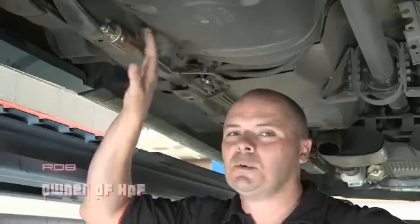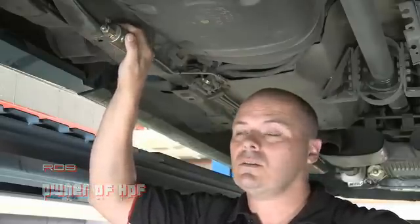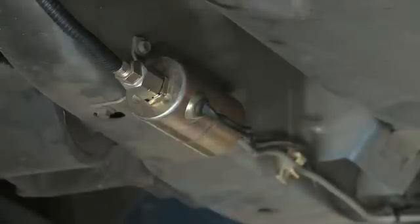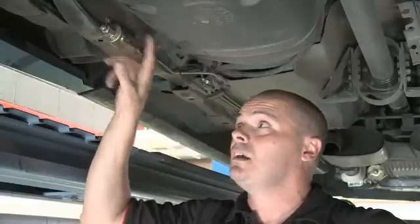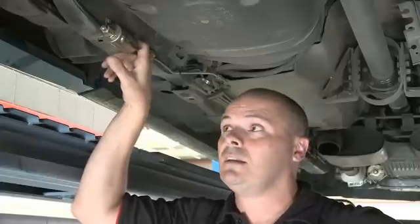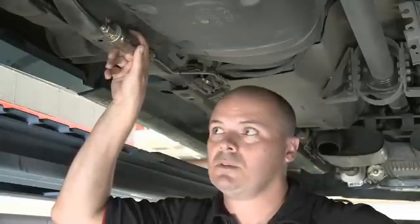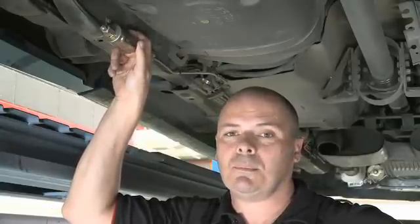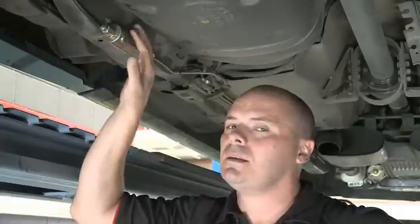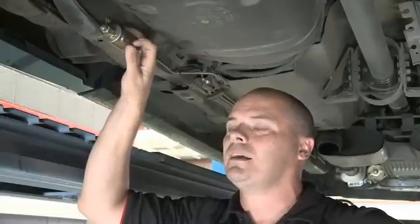What I've got here is my little secret weapon that I've had the boys fit. This is what's commonly known as a line lock. Basically it's an electronic solenoid that stops the brake fluid travelling down the line and activating the rear brakes. By simply pushing a button on the dash, it operates that solenoid — I put my foot on the brake pedal and only the front brakes are activated. That's going to help me a lot when doing a burnout because I don't have the resistance of the back brakes slowing the wheels down. I can also use it to control only the front brakes for steering. So don't tell anyone — this is my little secret, and I reckon it might make all the difference to making the finals.